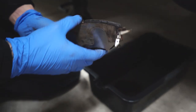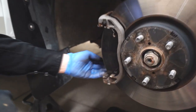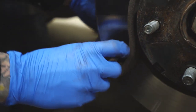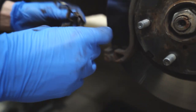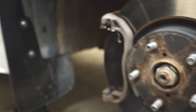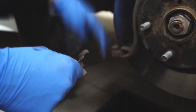Starting off by taking off the shims — rust will usually build up underneath and on top of the shim, creating micro vibrations as well. It's good to remove these to do the proper cleaning. You can see underneath it's pretty dirty, with some uneven rust buildup. It's usually not as bad on the top because water runs down and sits in these channels.